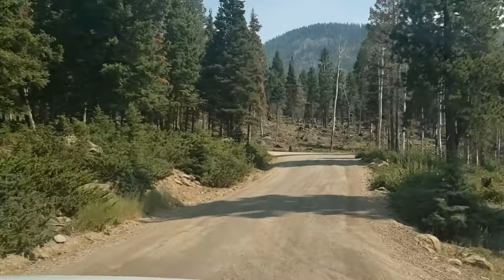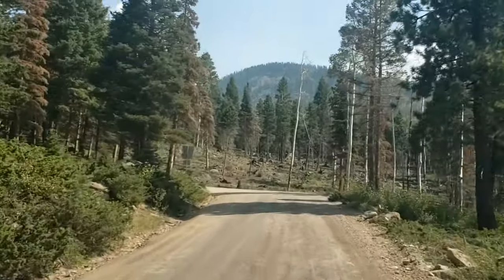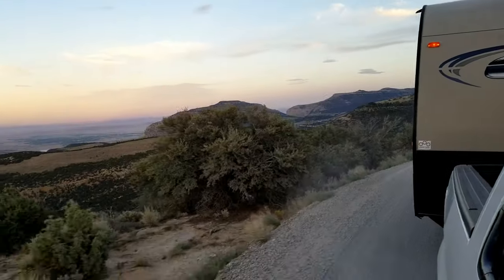In my case, I use grease. Does it get dirty on dirt roads? Absolutely. Does it hold up in the rain and the snow? Absolutely. It's worth it to me to wipe off the dirty grease from time to time when we go down dirt roads — we go down an awful lot of dirt roads. So in my case, we're going to get dirt in that grease and it happens all the time. I clean off my trailer ball sometimes every trip, it's that dirty. But really it's a small price to pay and I don't mind doing it.